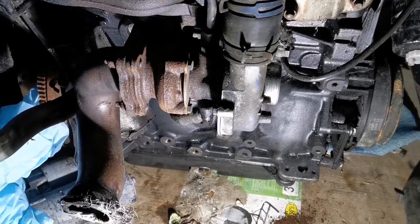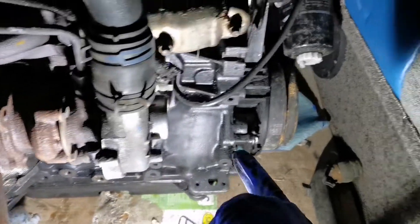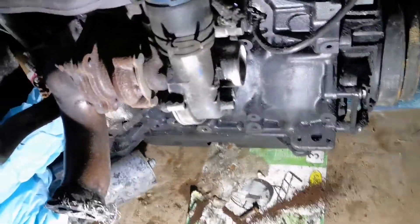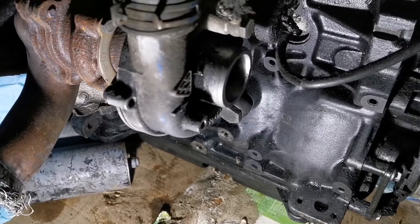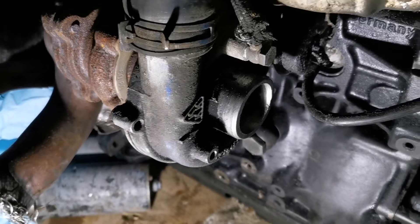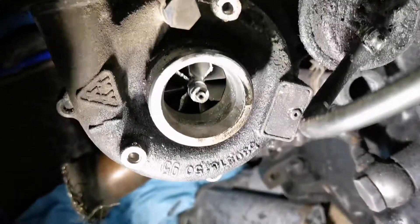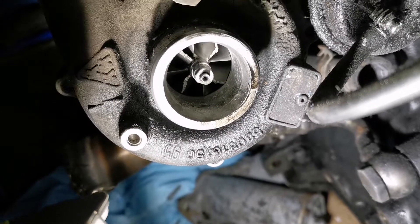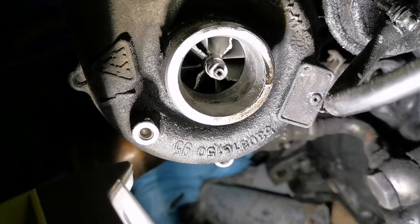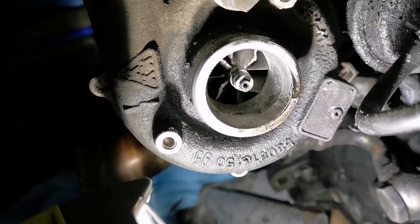I managed to swivel the engine around, and here is the offending article. This is the turbine side of the turbo, and this is the compressor side. Air comes in here and comes up here and in through an intercooler, which cools the air, and it goes into the intake. The reason the air gets cooled is because colder air is denser air, and the more oxygen you have in the air the more bang for the buck you get. If you see in here, that is where the compressor is, and unfortunately this turbo has eaten something. There's a little bit of damage to the compressor shroud as well, so we'll have to dress that up. My main concern is the fact that the compressor impeller itself is in bits. We need to address that, and that's why I got the new CHRA.